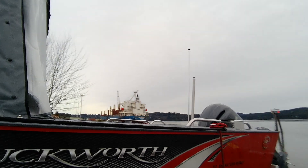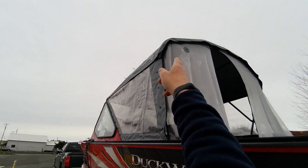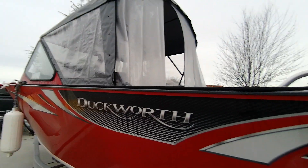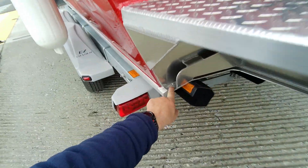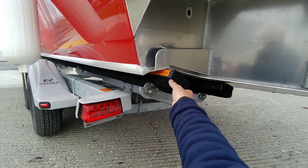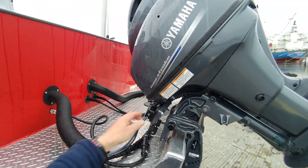Here's another nice thing on their backdrops — these snap on the inside and then curve back and attach up there. The reason for that is they're not on the outside, so the wind can't catch them and they don't flop all over the place when you're going down the water. It's got a reverse chine on it right here. You can see that reverse double all the way up — that keeps the boat stable. These trailer bunks need to be adjusted, pushed down. The other side does too. Welded on zinc, which is good. You've got your kicker.